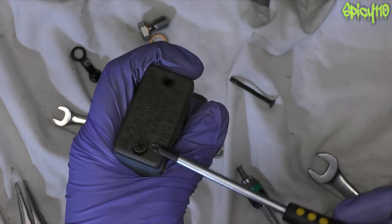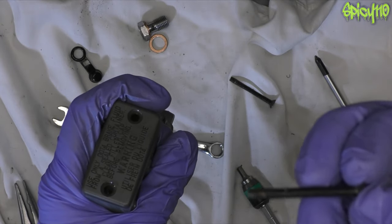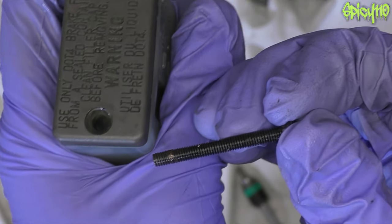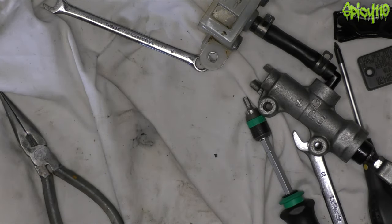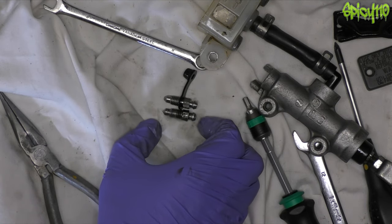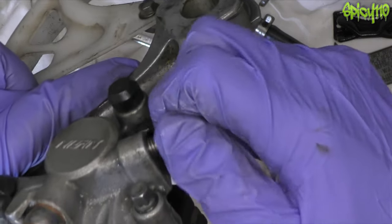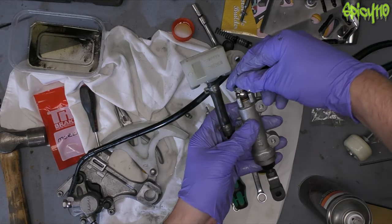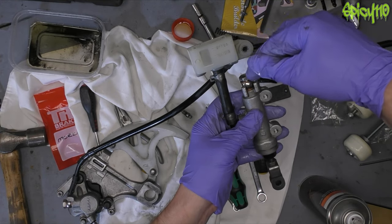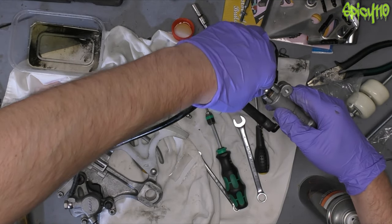Something I've been doing recently — because these love to get stuck on lots of different bikes — I've been putting the tiniest amount of copper grease. Can you just see there's a tiny bit at the bottom there? Just a tiny bit on there, and it stops it from seizing. So that's that bit done. It's got a rounded tip rather than a point tip on it, but we'll soon know if it's not working. You should replace your crush washers each time you do this if it needs it. These are literally brand new crush washers — they've had one crush on them, so these will be fine to use again for this instance.